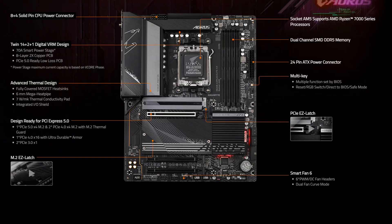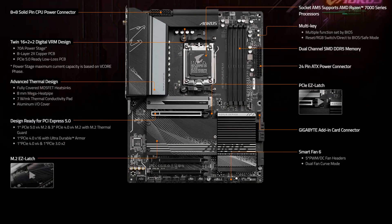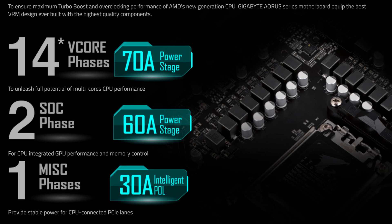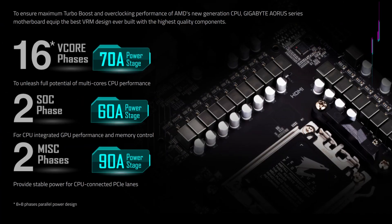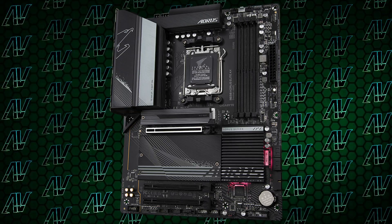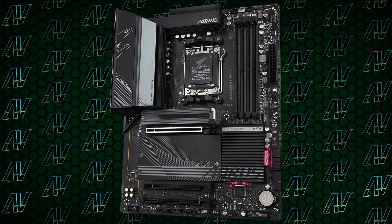Especially seeing how feature-wise, this motherboard isn't too far behind the much more expensive X670 AORUS Elite. Starting off with the CPU power delivery situation, things are looking pretty standard with 14+2+1 power phases rated for a maximum of 70 amps. That is less power phases than the X670, and you only have an 8-pin and a 4-pin for CPU power compared to 2 full 8-pins, so your CPU will receive less maximum power. But unless you're a hardcore overclocker, you'd have to be absolutely psychotic to tell the difference between this and a much more high-end motherboard. The VRM cooling is also pretty much identical between the two boards, so honestly, I wouldn't worry about this downgrade.